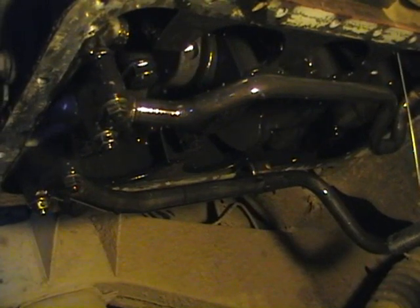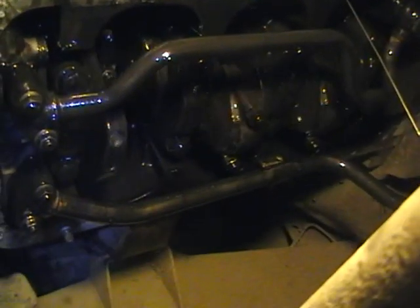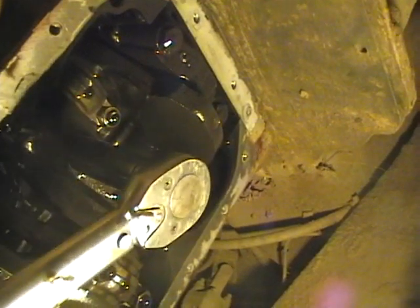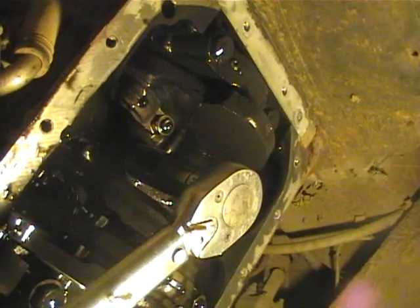Well there's my engine, going round and round. You wonder what an engine looks like inside? Here you go - looks a bit like that. The crank pins look okay, there's no deep scarring on them. So I don't think the crank really needs any attention - it's in pretty good shape. They all look good, do the crank pins.